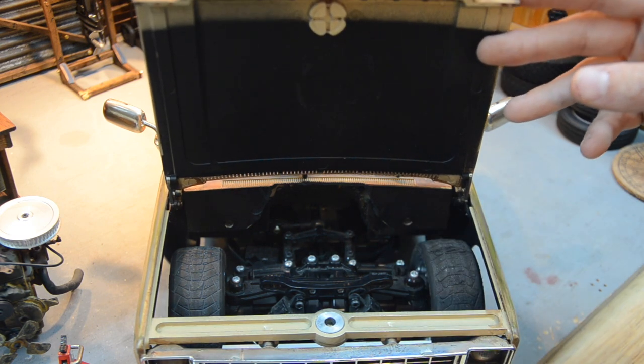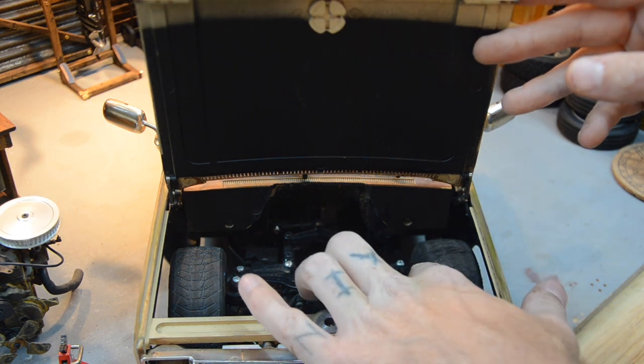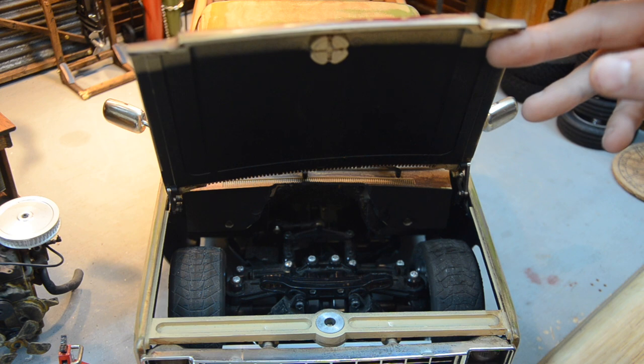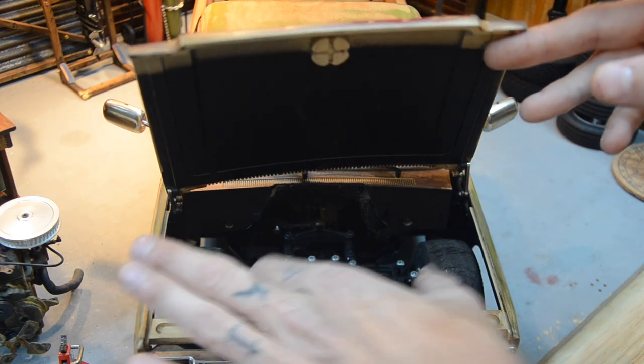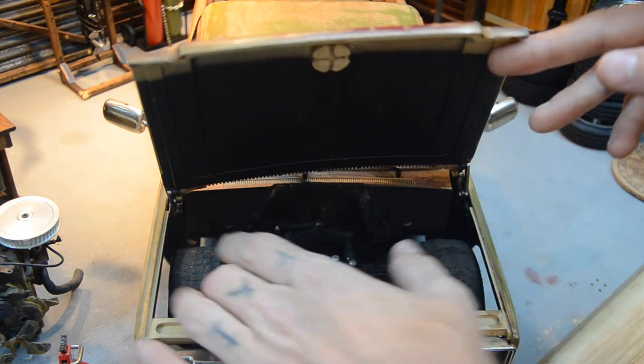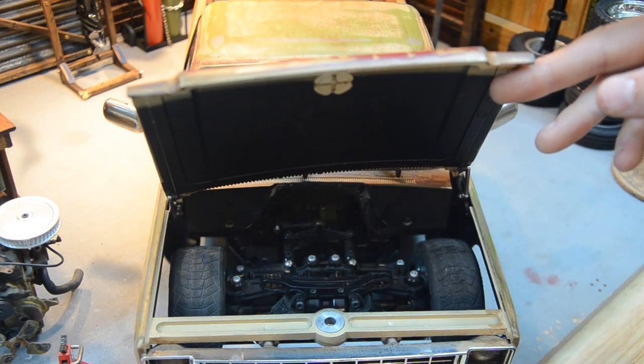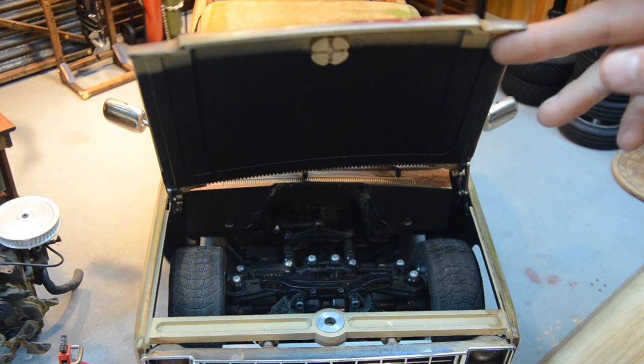We've got plenty of room in the steering. I do need to come back and trim our front body mount. There's no way I can get the camera in there. That angle piece of aluminum that we use from the grill mount to the chassis, the tire at full lock does hit the corner of it. So we just need to cut down the edges of that a little bit. A few little odds and ends to take care of.